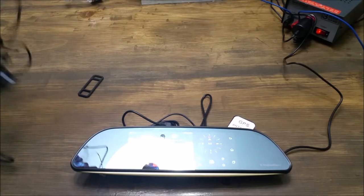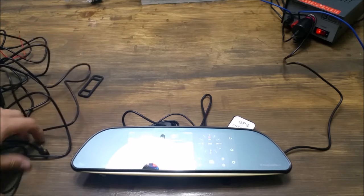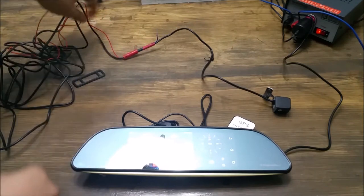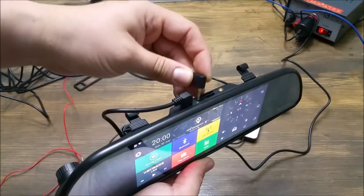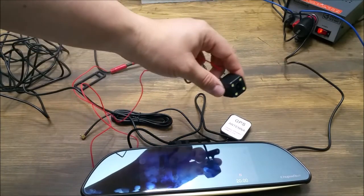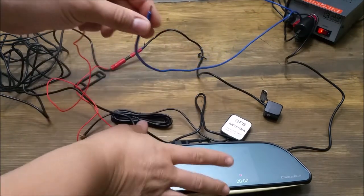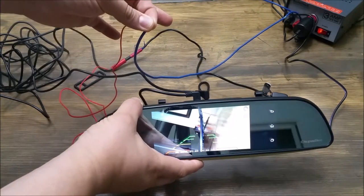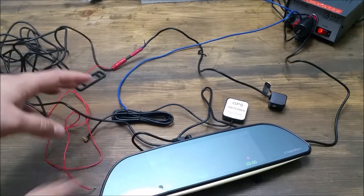I want to walk you through the settings. This red cable that comes on it is a power cable. You're going to tap that into your rear backup lights, so that when those backup lights come on, it sends a signal to turn the camera on. You can turn it on through the menu or that way. This is a positive wire that simulates the backup light coming on — when that light comes on, it gives power and automatically changes the view to the rear view, which is awesome. Then when you turn it off, it goes back.